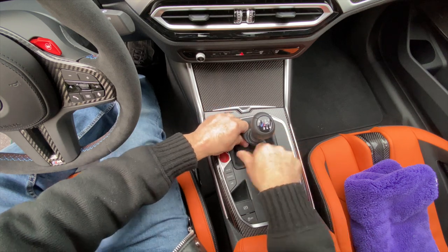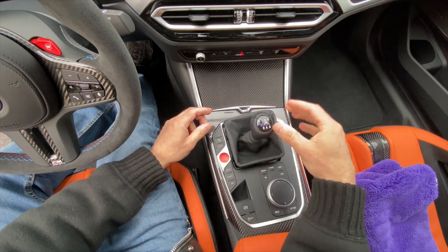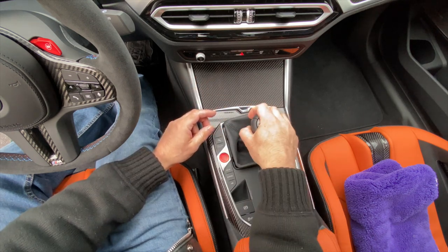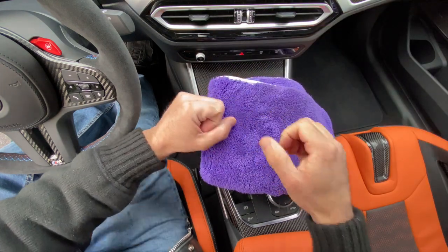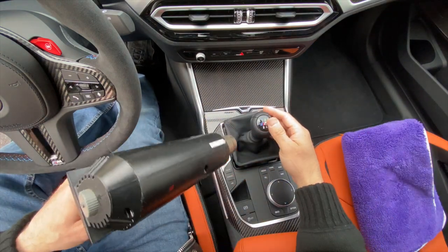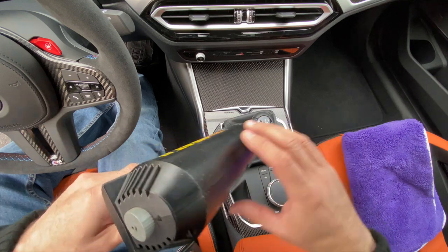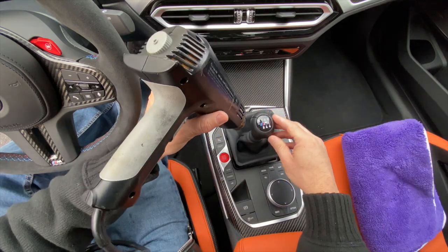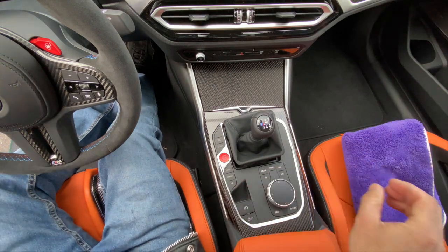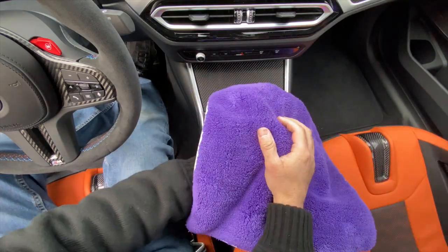For removal, take the leather on the boot and just lift up to release the boot. This is a press fit with no threaded fixture, so we're going to put a threaded adapter on here. I like to heat these up and then take a thick towel, place it over the knob, and pull — so you don't smash yourself in the face. Use the heat gun on a medium setting; it'll help the plastic expand inside the shifter shaft. Just want to get it warm.